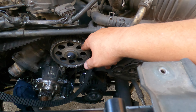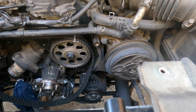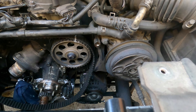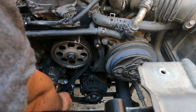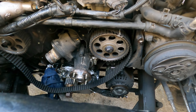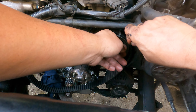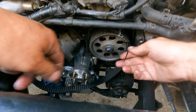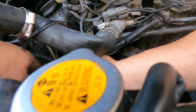This one goes a different way around - this one for that one, and this one for that one. One of them was moved so make sure you put them on correctly. When you have a new belt, put them on and make sure you line up the marks exactly the same. All you have to do is put them on the right position. You'll need to tie them with a cable tie, but if you have two people it's easier. I want the white mark to go back here exactly the same position.